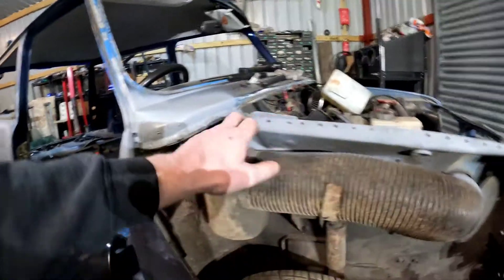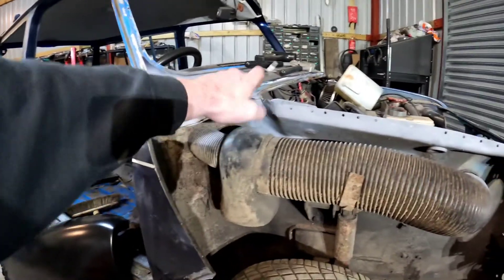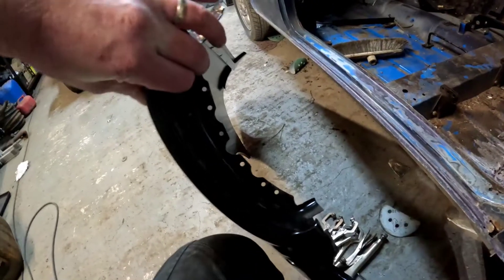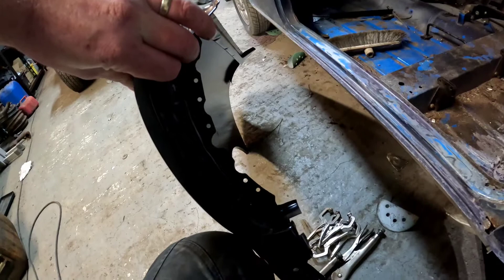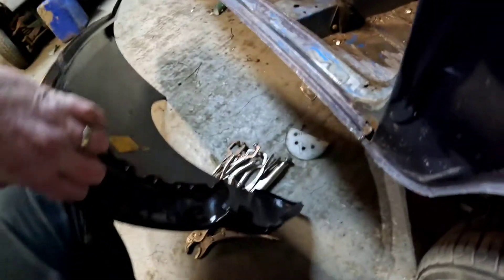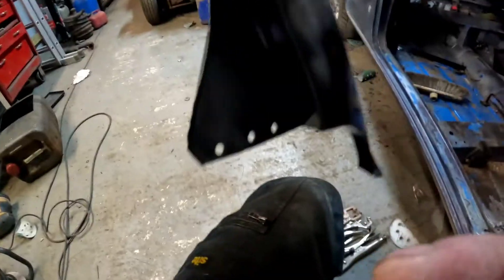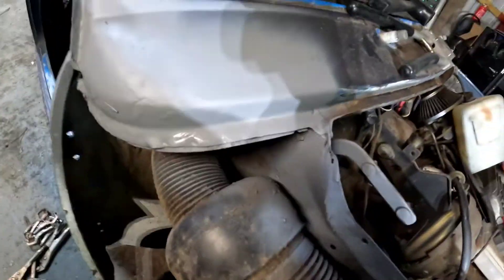They're a good tool to have for welding the wing on. Cleaned up all around here. I've given it a quick coat of primer, but I'll have to take some paint off where I'm going to be welding. Cleaned all this off. I've got the wing — you can see I've punched some holes around there ready for spot welding on. Some along there for welding onto the A panel, and there's some across there for welding onto there.